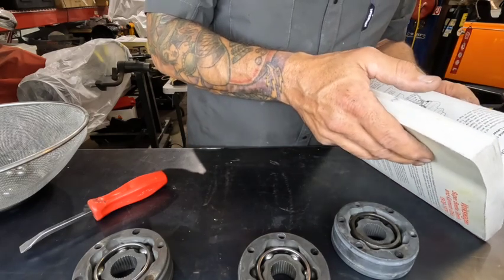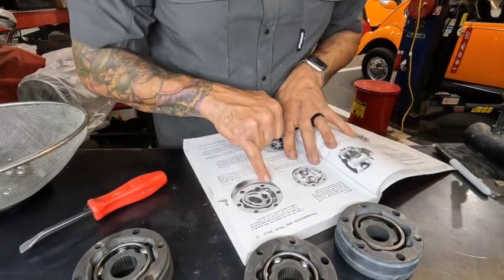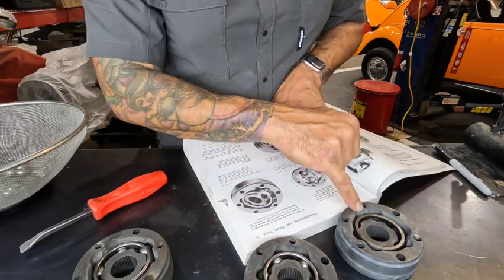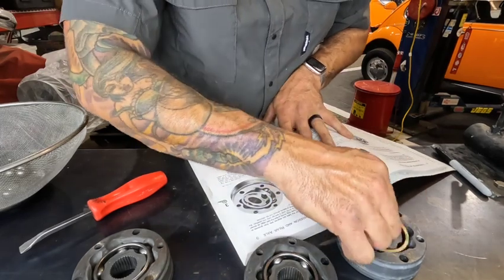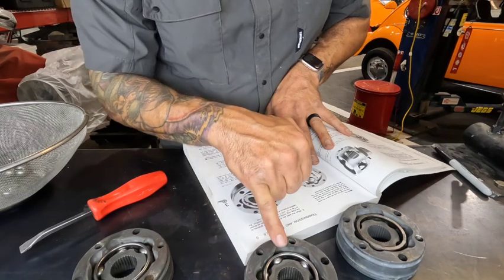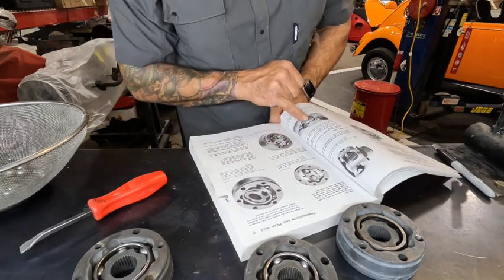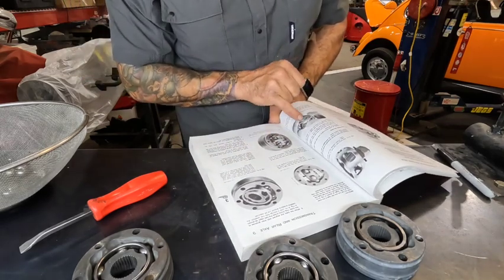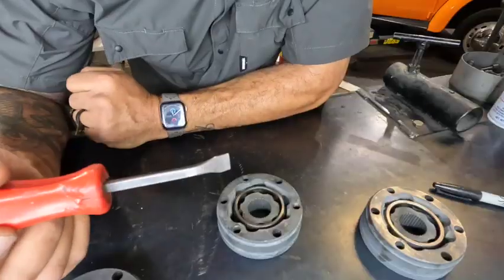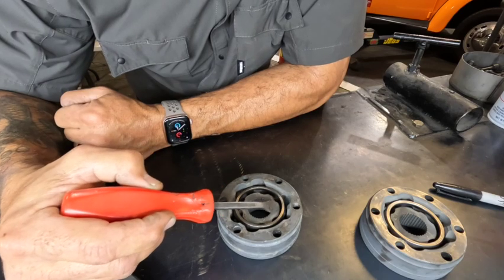In this diagram right here, you see the cupped edge we're referring to — you can see the groove there, and no groove there, and a groove there. This is not together by the way, just sitting there. So the groove side faces the cup edge, and then this is our flat edge. They show you on this one where the chamfered edge is for the driveline install. So I know this one is correct and this one is correct, and I got two more to build. The basics of CV: big side, small side, small side, big side — referring to these flanges.